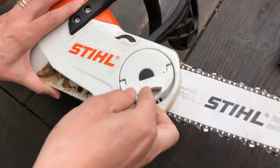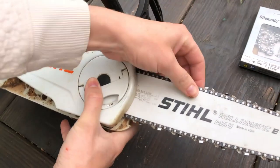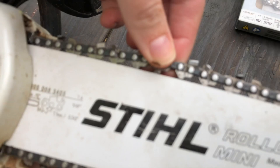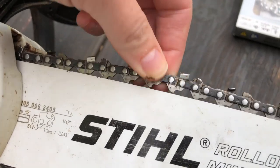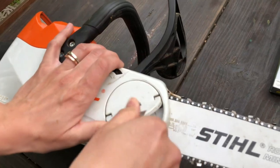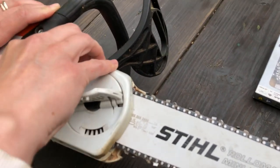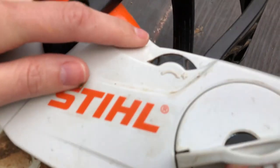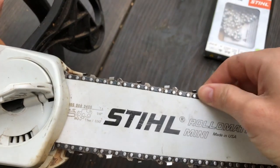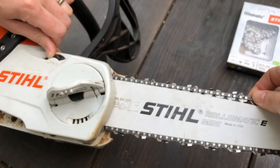This is how you tighten the chain and how you loosen this entire cover. If you have a chainsaw and you think that the tension is off, pull it up and you see that the blades are out — too loose. You don't want to operate a chainsaw when it's like that. You're going to need to tighten it down. There's a knob you turn toward plus to tighten it up. Check this periodically as you're tightening it. As you wiggle it, it should pull up and not be super tight to the bar, but have a little bit of give while staying in the chain.